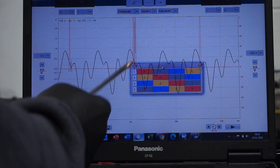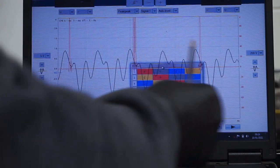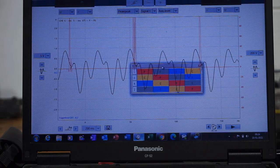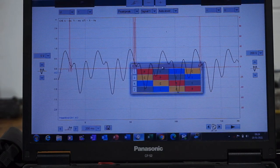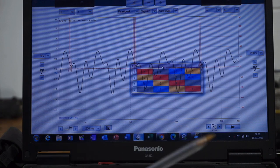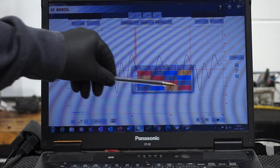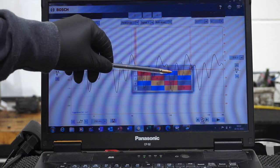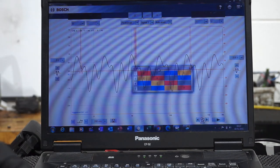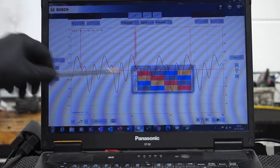We're synced to injector one, so this is 720 degrees of crank rotation — the crankshaft has turned twice, the camshafts have turned once, and the engine has gone through a full cycle with all four cylinders having fired. As you can see from the piston chart, different colored squares represent different strokes: red is power stroke, grey is exhaust stroke, blue is intake, and yellow is compression. Since this is an intake waveform, what we're interested in is the blue squares.